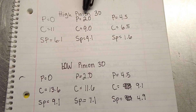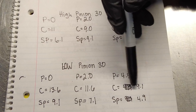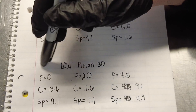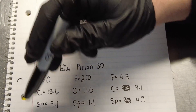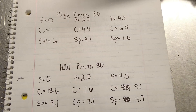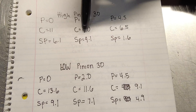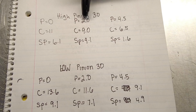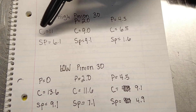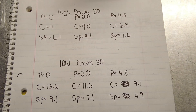Because the driveshaft is higher on the high-pinion, we can now eliminate the 4.5-degree clock of the pinion and be more around 1.5 to 2 degrees. Look what happens to the caster — it's about the same as stock. At zero degrees, you have the best lubrication on the pinion by design at factory heights. So anything over 4 inches, not only do you need to cut and turn C's, you're also losing the lubrication the pinion was designed for. With the high-pinion Dana 30, I only need to clock it around 2 to 2.5 degrees at most, and I'll still be between 5 and 10 degrees caster — though you'll need to take your Jeep to an alignment shop to sort that out properly.